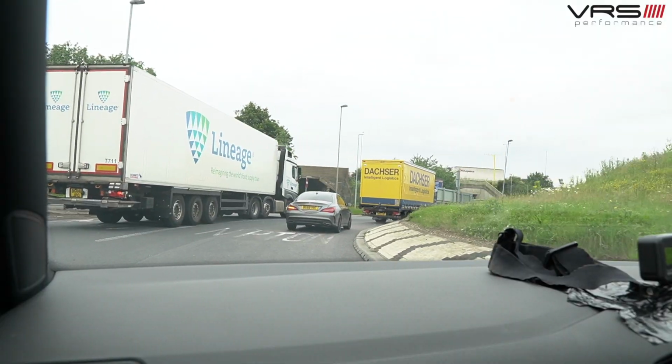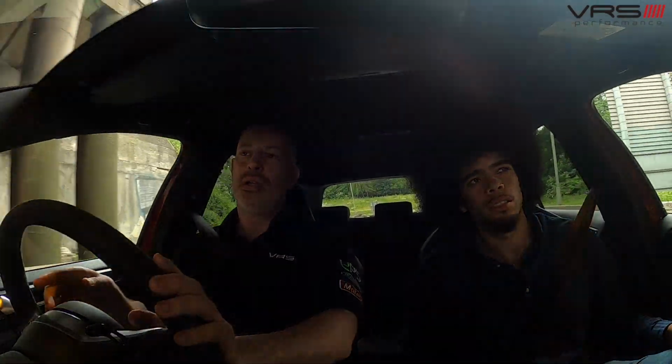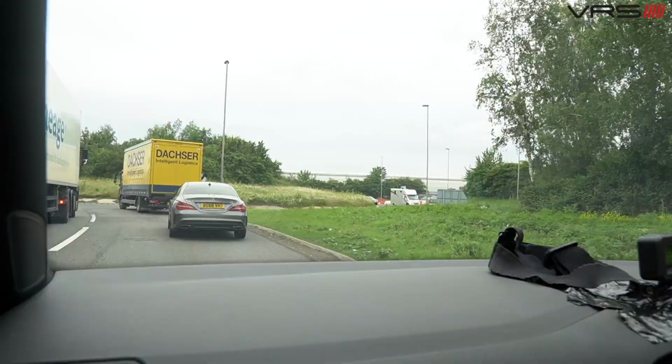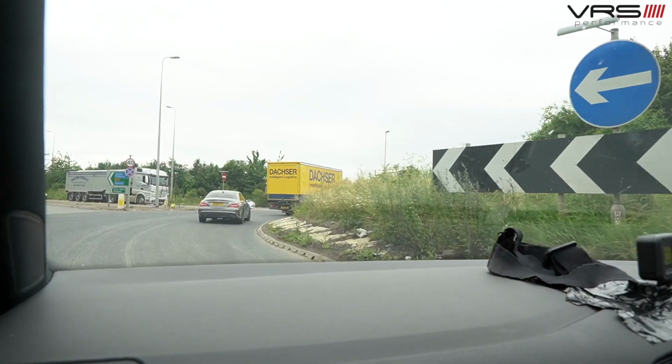Well, I've certainly learned something new. I didn't know how you calculate back pressure, and it's interesting that it's the difference between what's coming in and what's going out. We tend to run that when we test stuff. So if we test an intercooler, we'll put a pressure gauge on the outlet of the turbo, so we know what is coming out of the turbo and what's on the inlet. And I can tell you whether an intercooler is any good or not by the air temp coming out of it, and the back pressure inside it.